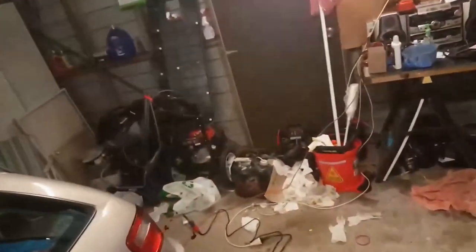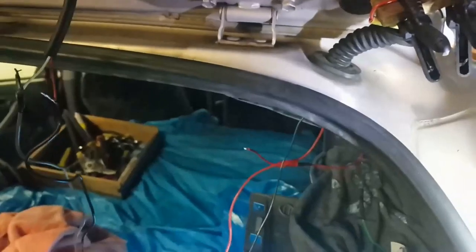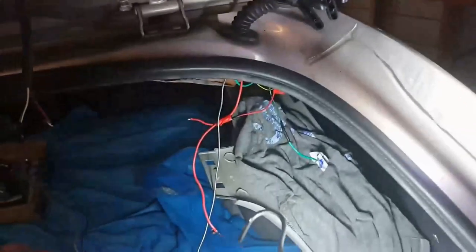I would think twice before getting a station wagon again, just because of the complexity of the lighting and any electronics in the back tailgate — the wires do have to come through. How I do my soldering: I've got a small wooden block and a couple of clamps, and I've got my flux. I apply the solder with a soldering iron. You can see this wire here — that's a piece of coat hanger that I've used as a chaser to bring the wire through. It's very important to round off the tip of that with a file and put some motor oil on it, otherwise you'll rip your way through the other wires and destroy some wiring in there.